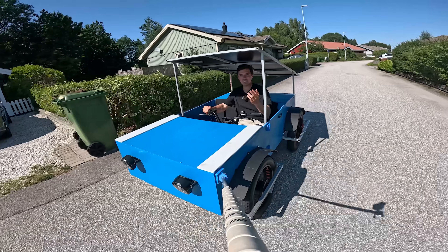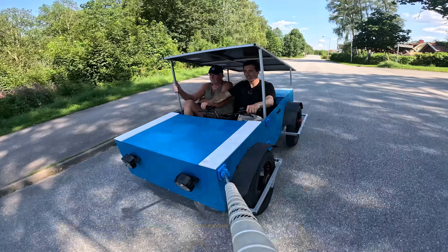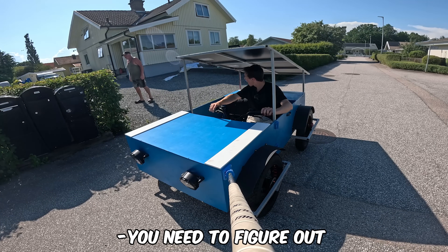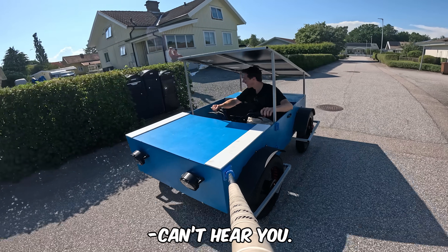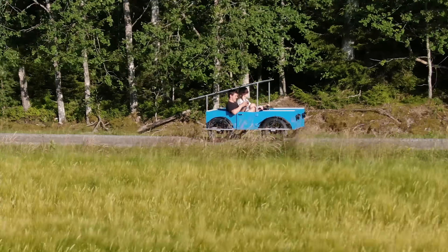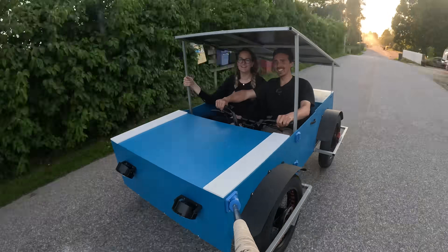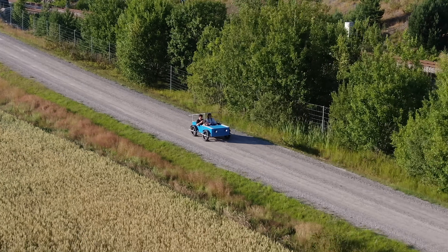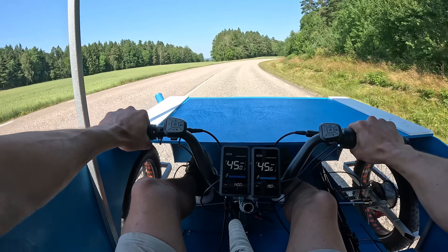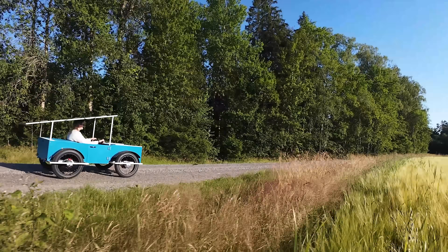Let's go and pick up my old neighbor Christer — I just know he'll love it. This thing seriously delivers. I was able to go 30 kilometers and the battery was still showing full. Realistically, I'd be happy if we could go 100 kilometers on a sunny day. Even before heading out we had already generated a quarter of the entire battery, so the solar panels absolutely help to increase that range. Full speed I was able to hit 45 kilometers an hour, which isn't bad at all — at 48 volts you're not going to get much higher than that. Where this thing really shines is the raw power — being able to climb basically any hill with four wheels spinning locked onto the ground makes it quite unstoppable.